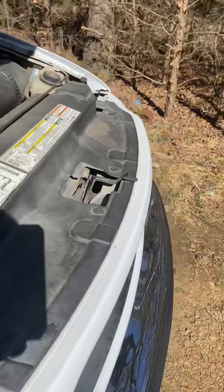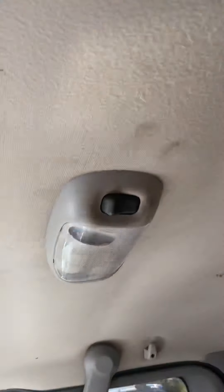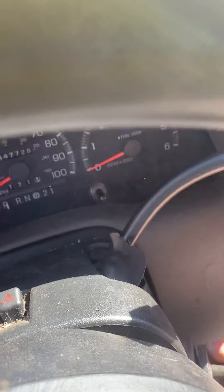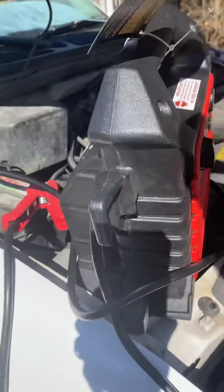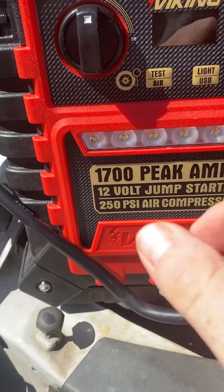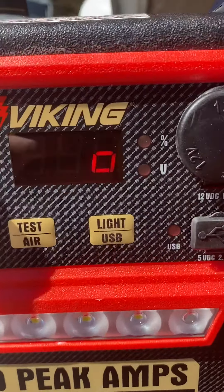This is still off — I'm going to show you that this truck is dead, dead, dead. The key is in the ignition, there's no dome light, the door's not dinging, no gauge response whatsoever. Now we're going to give this a go and see if this thing really has juice. Come back here to our safety door — power back up. Got a decent bite there, but those cables are pretty rusty. It's reading low volts.